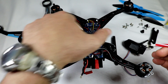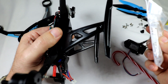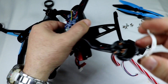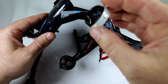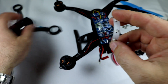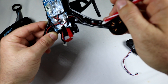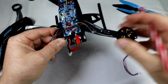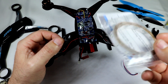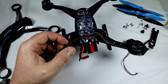First I'm going to go through the light mod. This one's been done before by some other people. Originally I was going to put these strip LED lights on here - this is an LED strip where you can cut it and you can do three at a time - and I was originally going to have them go like this on the outside of the arms so they had really good lighting. But unfortunately these wouldn't light. I wanted to use the existing wires in here but when I put my voltmeter on here, these are only two volts and wouldn't power these LEDs. These LEDs require 7.4 volts to light them, and I don't think they'll light up with anything under five volts. So I scratched that idea.